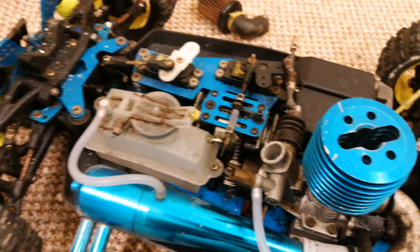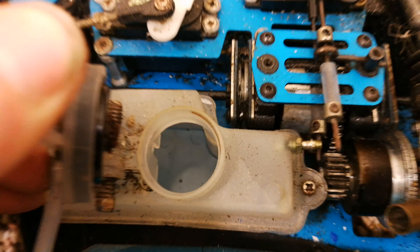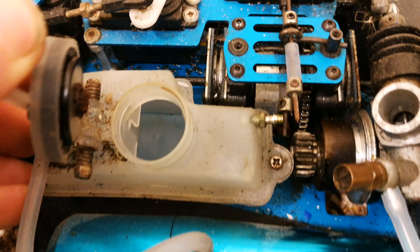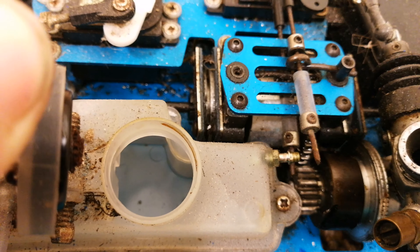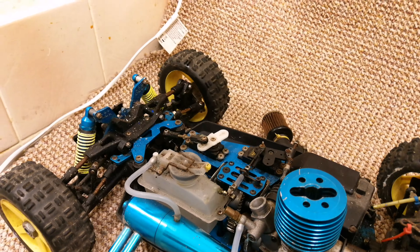So you've covered your air filter and your oiling. Next, move on to the fuel tank. Never just chuck fuel in and rely on the built-in tank fuel filters — there's a good chance they are clogged, even the brass gauze bubble ones. You want to remove your tank, which I'm going to show you now.